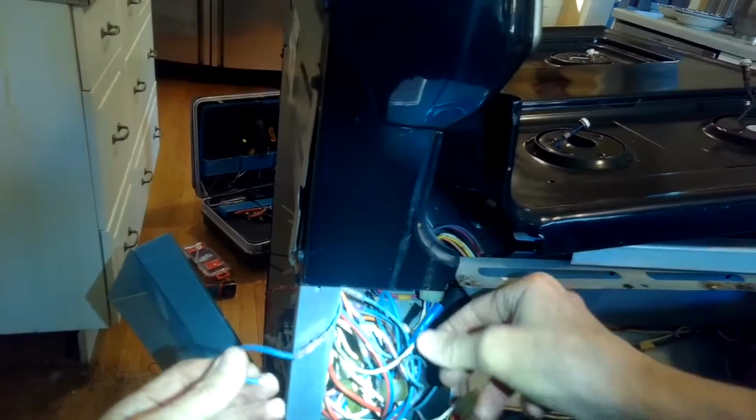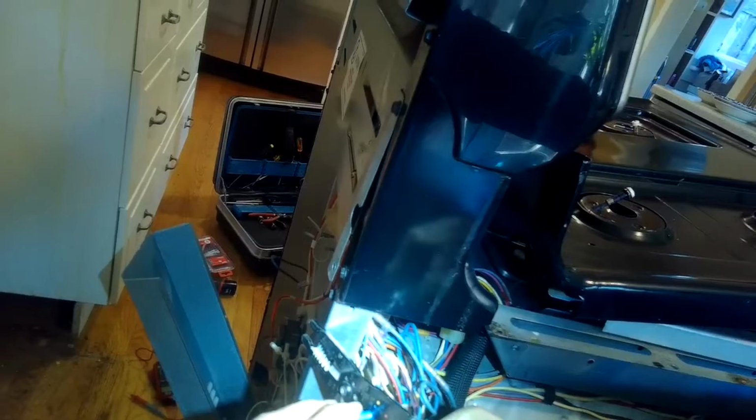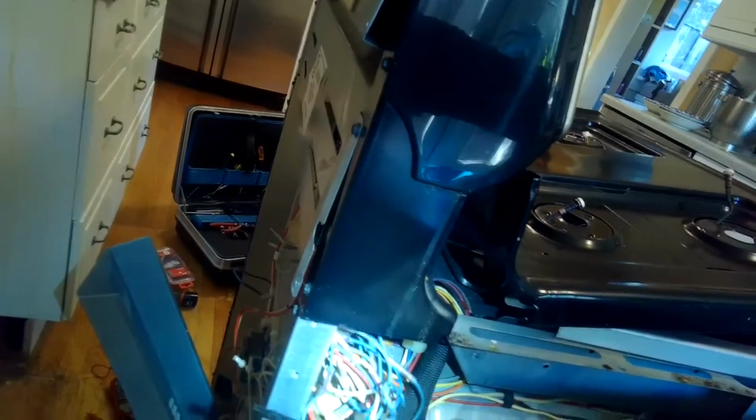Interesting, when I was looking online for this GE type oven, there's no videos that show how to take off the side panel. And my suspicion was that's where the damage was. So this is kind of fun. Hopefully will help some other people who have to remove the side panel. So I'm crimping down now on that connection, and I'll use some electrical tape too to surround that, just to give it a really good, safe insulation.